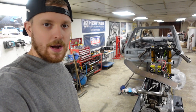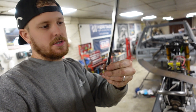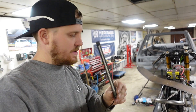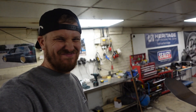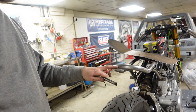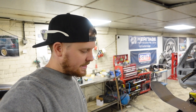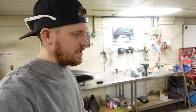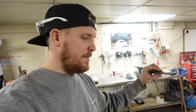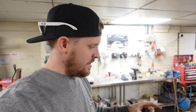The first thing I want to do is french — as I keep referring to it — this rear light into the seat hoop at the back of the bike. The rear light is this all-in-one little piece: side light, brake light, and left and right indicators all in one unit. Some people just stick them on the outside, which looks like an afterthought in my opinion. What I want to do is cut a slot in the hoop, slide this up the tube, and all you'll see is the clear lens and LEDs. So I'm going to drill two holes, join them up, and cut that out.